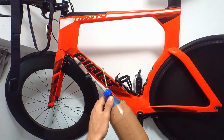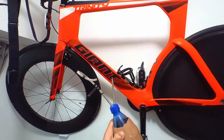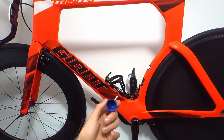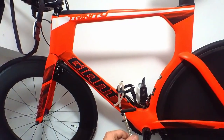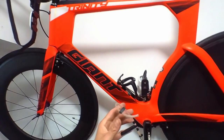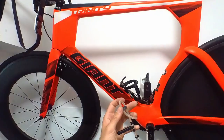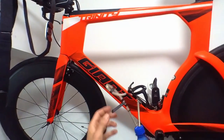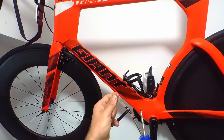This is a one-and-a-half litre Schweppes bottle. I've got two small five-mil holes in the cap, and two old Presta valves taken from old inner tubes with the locking nuts on top, then a small bit of plastic pipe — four by six mil — which I took from my Shimano brake bleed kit, and basically a small rubber band. This is actually a cut bit of inner tube used to hold a fold in the tube. When you fold the tube like that it makes a really good airtight seal, and that stops it coming down. When you're ready to release, you just take that rubber band off and all the pressure comes out through that and pushes onto the Presta valve on the bike wheel.